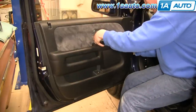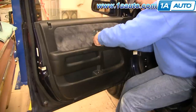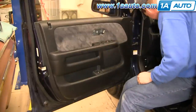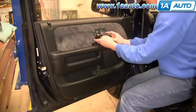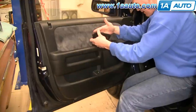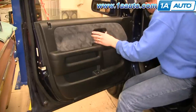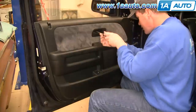Hold on to the window harness. Put the panel down in, connect it, and then connect your mirror harness. Work this down in and lock it into place. For your door handle, connect your power door lock switch first. Pull this clip back a little bit, pull your rod out and get it into the hole, push it down and put that on. Then use a Phillips screwdriver to put in the two screws that hold that door handle in place.